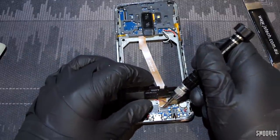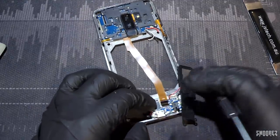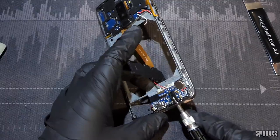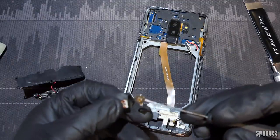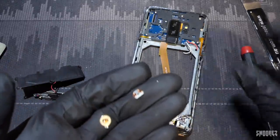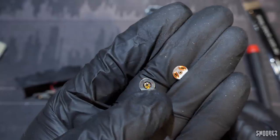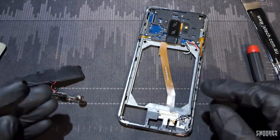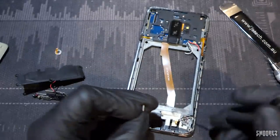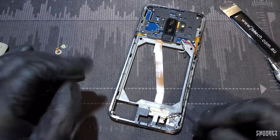So now what I can do — I've got glass shards everywhere. This S9 Plus is cursed — glass shards with the previous one, glass shards with this one. I can now grab out the sub board. Take the sub board out, take the microphone out. Everything's pretty much loose. I just broke the vibration motor on this, but the coin-style vibration motor has several interesting parts — it has two coils on it and there's a little PCB just in there. There's a little post that this goes on and then that spins around to make it vibrate.